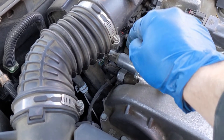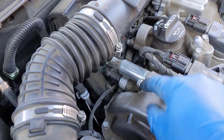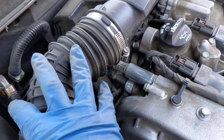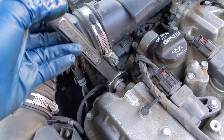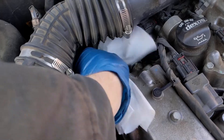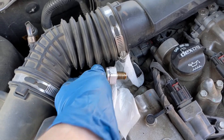Back under the hood. We want to remove our VVT solenoid so we can get better access to our oil pressure sensor. The electrical connectors can come off — 10 mil bolt here and this will slide out. If you need a little more room, you can take off the ducting, but you should be able to do it as is. Now we have plenty of access to get a 24 mil wrench on there. We'll bust it loose. If you don't have a 24 mil, a pair of channel locks, vice grips, or a beefy pair of pliers should do the trick — it's not on there too tight. I'm going to put a rag underneath to catch any oil, and then we'll just twist off the sensor.